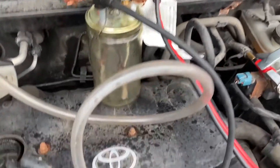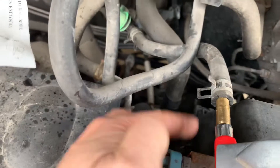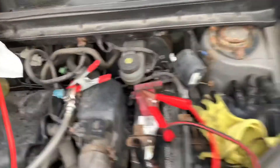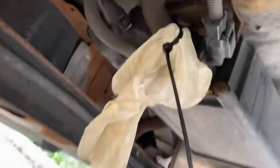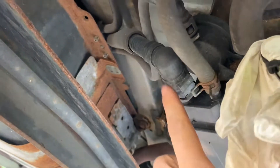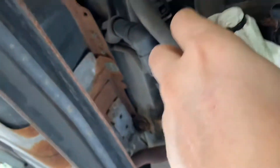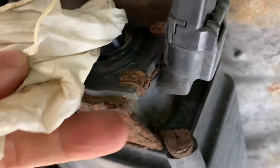What I do is take off this purge valve and put the smoke through here. The smoke goes into the canister, then back to the fuel tank right here. And somehow it's blocking the vent valve — because this is a normally closed valve — so I unplugged this.